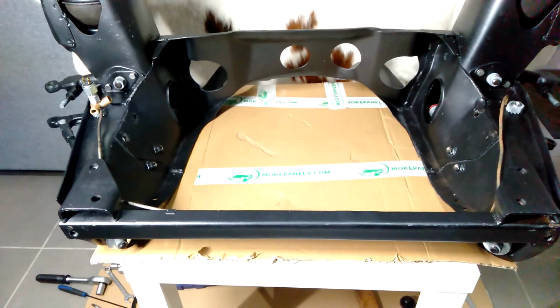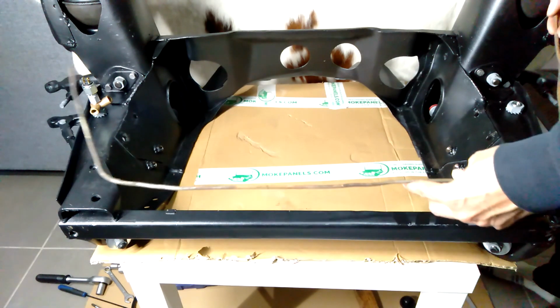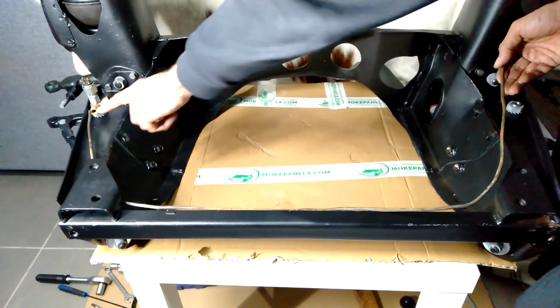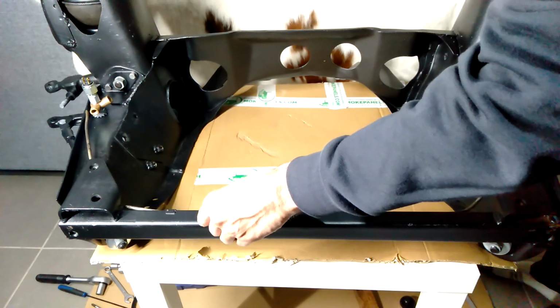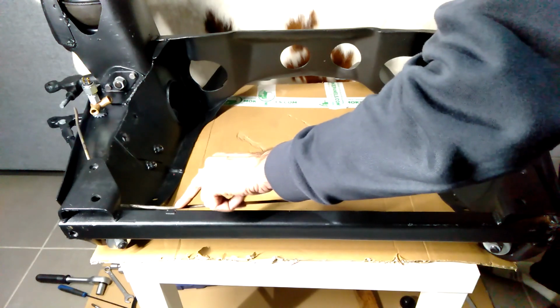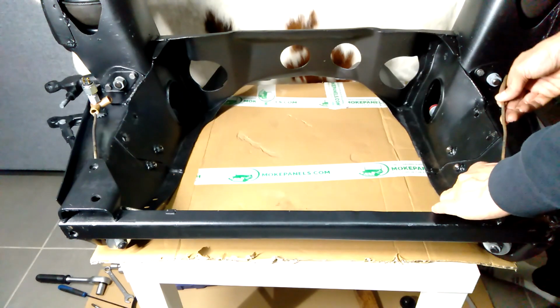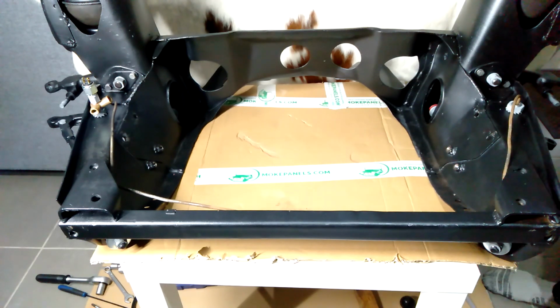All right, so here's the original brake line. It's a bit bent and twisted because it wasn't looked after. I just rebent it to the shape it needs to go. So it comes straight down there. Just be mindful of those bolt holes for the bumper, and then the actual pipe will sit under there. There's a little bracket, so it will clip into that. And then there'll be another one I'll have to put on over here, and then to that point here. So I think if I just get the length cut first, then I can work on the fittings.